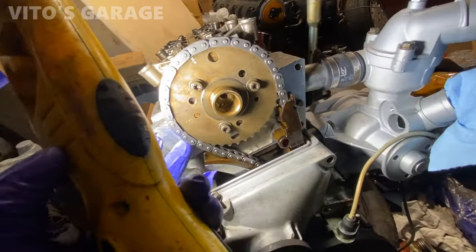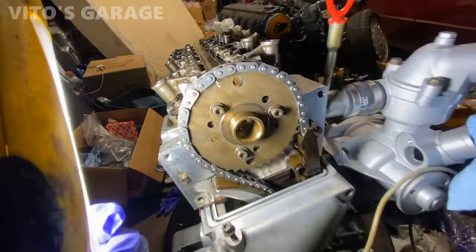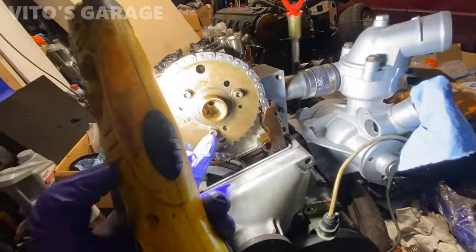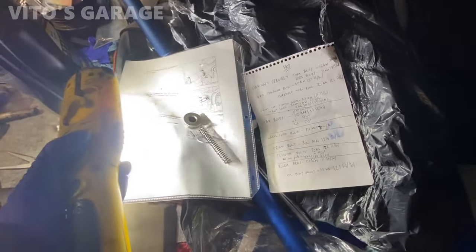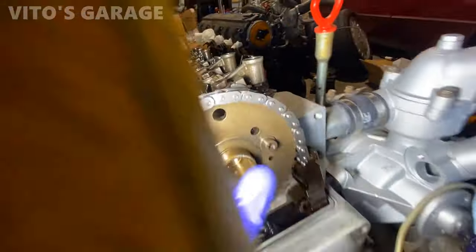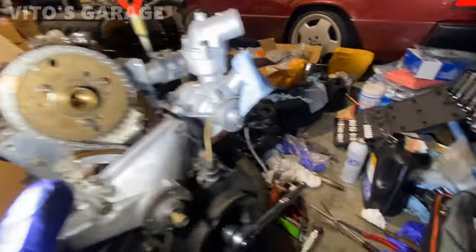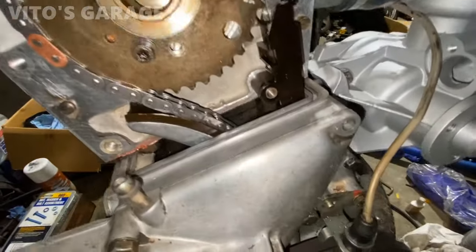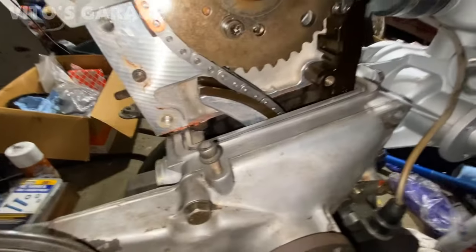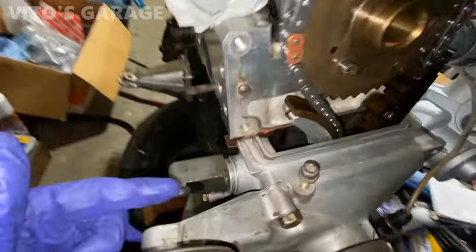Okay, so this is actually my link where I connected the chain, and I crimped that with a timing chain tool. And yeah, these are torqued to 22 foot-pounds. Torx bolt, 16 newton meters or 12 foot pounds. These ones, 16 newton meters or 12 foot pounds. And now I'm reassembling this tensioner. Yep, there's a procedure for it too. Also using a brand new spring for that. Okay, timing chain assembled and everything. This guide is in. Chain is tight. That's in.